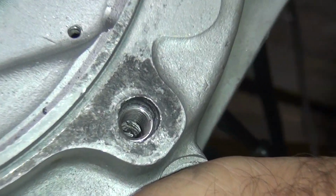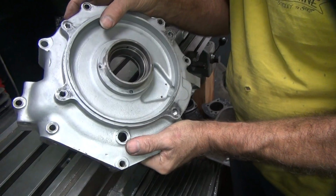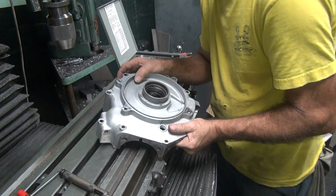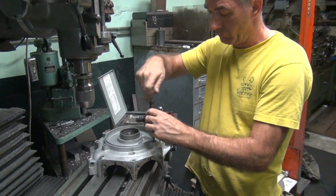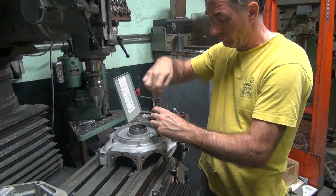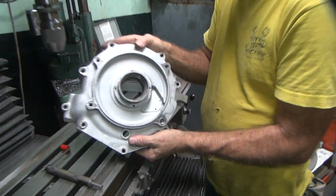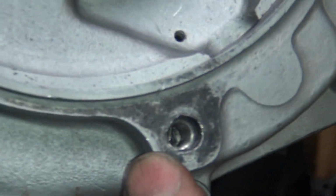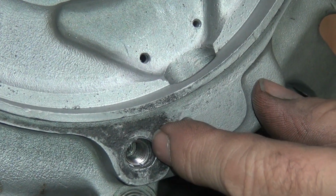Okay, so now we're mainly in good threads now. But right at the very top where it's kind of bad, now the tang has to dig in or it will unscrew. And right now we're kind of right in the middle of where we're at, but I don't think I can screw in much more. I think we're already too far down already. But I want to get the tang where it'll dig into some decent material. In the top one. Yeah. I want to be in a good thread. See, there's a thread there? Yeah. See, over here the thread was kind of not there.